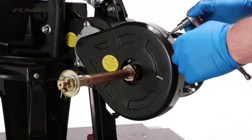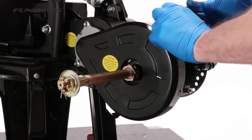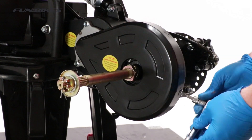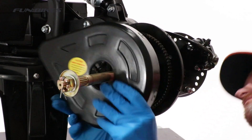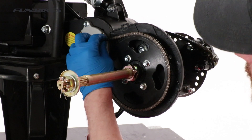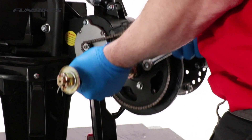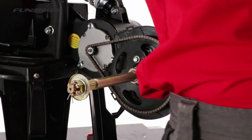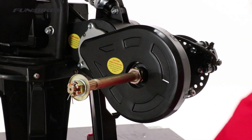We are now going to remove the chain guard using a phillips screwdriver to make sure that the chain is at the correct tension and the sprocket bolts are tight on the quad. The chain guard cover itself clips into position. As you can see the chain tension is correct on this vehicle, so we just need to tighten the rear sprocket bolts using a 10 spanner. Apply the rear brake when you are tightening the sprocket bolts. We can now reattach the chain guard and replace the 2 self tapping screws that help to hold it in position.